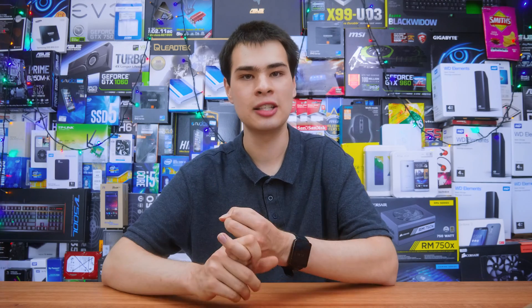The symptoms of bad blocks can also include things like the PC needing to repair its files on boot up, active programs crashing or freezing for no apparent reason, or even errors when saving, moving, or copying files. These are great ways to figure out that there may be some bad blocks in that SSD because you can't actually access those blocks. So use a checker to see exactly what's going on.